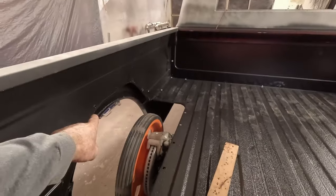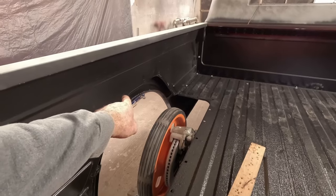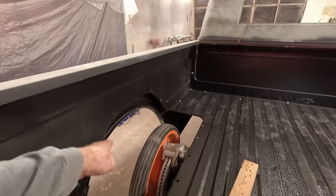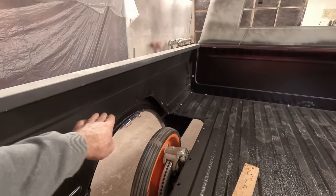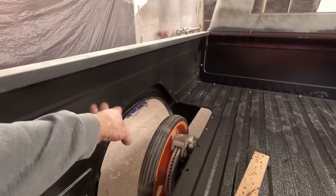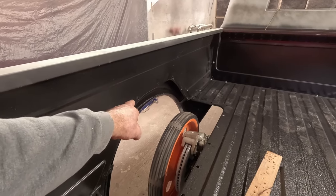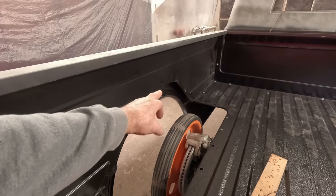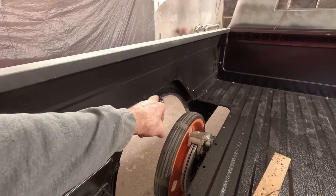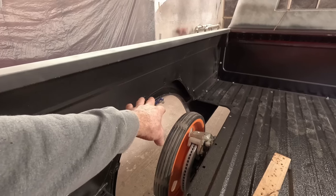And then I gotta make little wheel flares for inside here, wheel tubs. I had cut the old ones off because the way they come up at that angle, you have to tuck the tire way in. So I cut that off. I'm gonna make a flat piece and then down. So that's simple. Not a big deal for that. It'll just bolt on in the same place as the fender bolts on. And then the bottom, I'll use some screws and screw it on. So none of that gets welded on there, so that's easy to do.